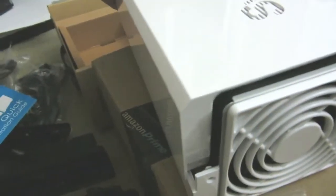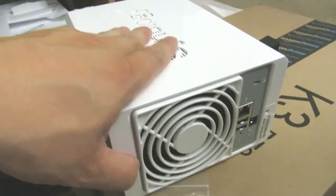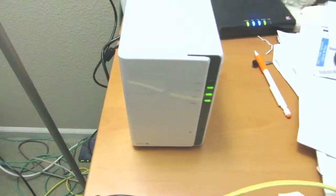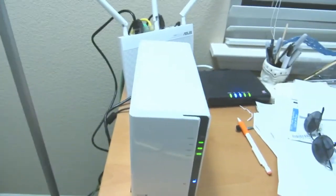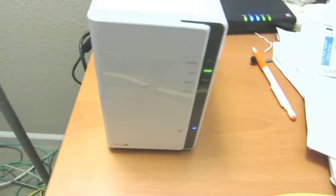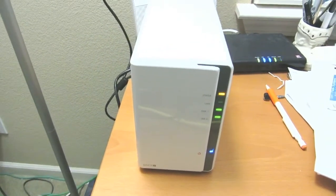The cover is easy to slide out and easy to put back in. The fan is not very noisy, as you'll see in my other video. Once both drives are in and the cover is back on, you power it up. All the lights start blinking — the power light is blue. Be patient while it sets up. The default configuration is mirrored between the two drives, giving you one file system mirrored for redundancy.